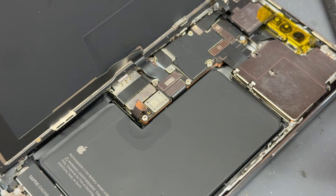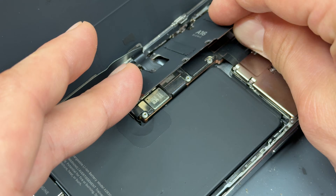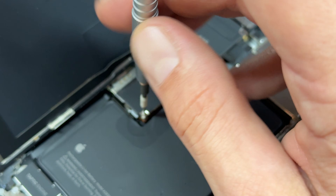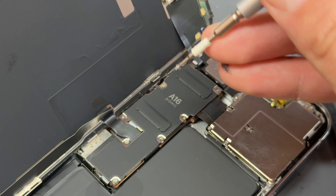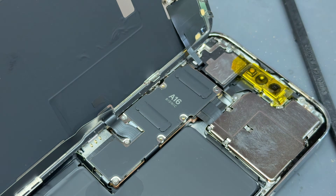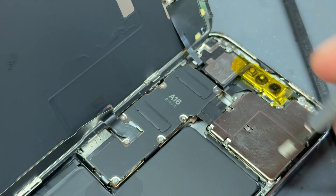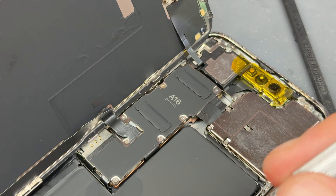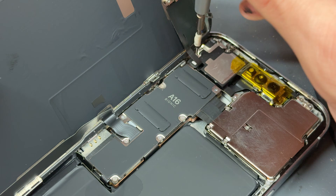Now that's reattached, we can reattach the battery and then drop into place the big shield that goes over everything. It's a little bit awkward at the top because it's got to slide under a little rail. Now it's just a case of reinstalling those screws we took out, making sure they all go back in the right place. The longest screw goes in the very top. You'll notice this one's a little bit longer than the rest — that's because it goes into one of the standoff screws underneath the shield. As long as you remember that, you'll be okay. And while I'm screwing these in — click that subscribe button and drop me a comment if you're having a go at this repair yourself.